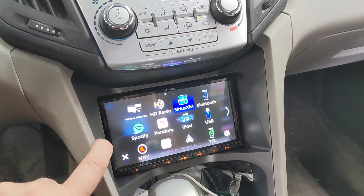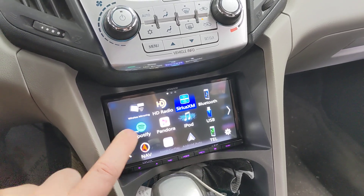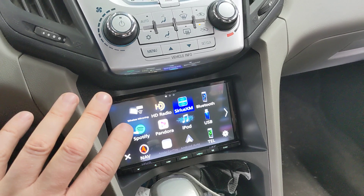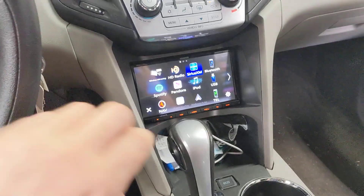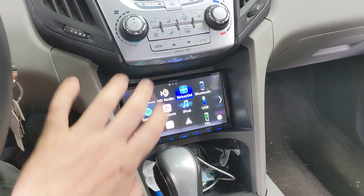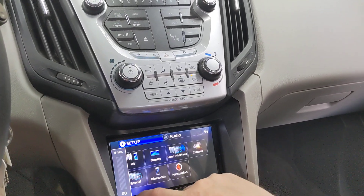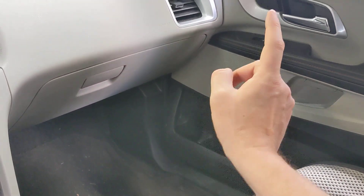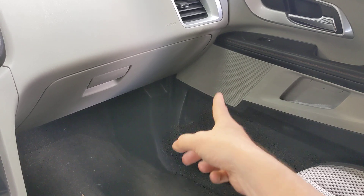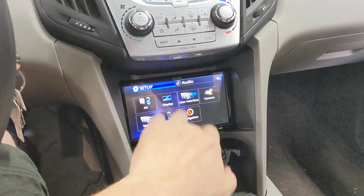This particular vehicle has no steering wheel controls, so nothing there to integrate. The dash kit — the 99-3308G — comes with the interface to retain the seat belt chimes, door chimes, light chimes, and all of that, so it's all included with the kit. The kit also comes with the bracketry to mount the radio down at the bottom. What it does not come with is the antenna adapter or anything for the speakers. The speakers are six-and-a-half-inch; we did a set of Kenwood coaxial speakers in the front doors as well as the back doors, which sound amazing with this radio.